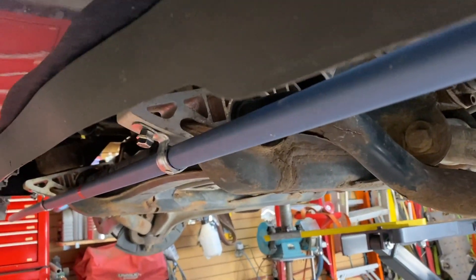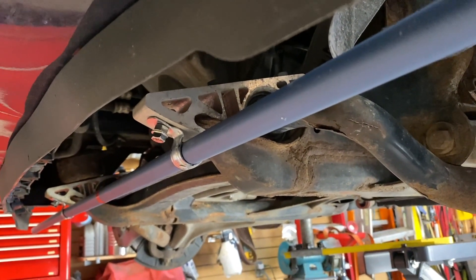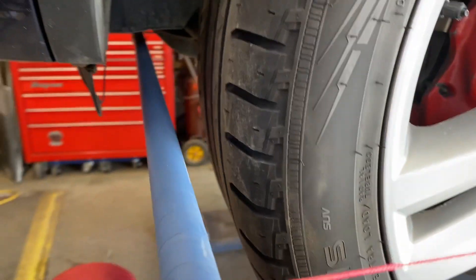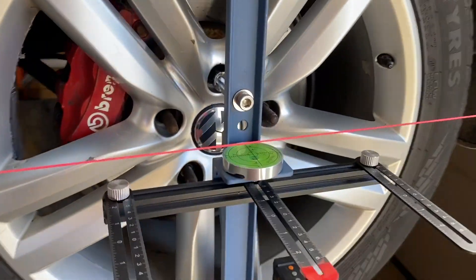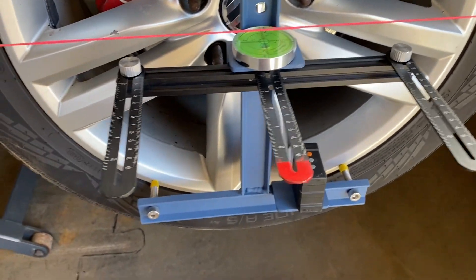What I've done is welded on a pipe and drilled and tapped the actual brackets for the anti-roll bar. I'll just unscrew that, put everything back, and there's just enough room to turn the wheels so it misses the bar. Going back — there's my string. Rear wheel, exactly the same. Everything is made exactly the same, within about 0.2 of a millimeter.